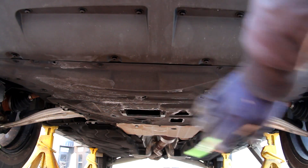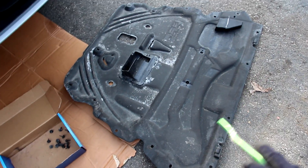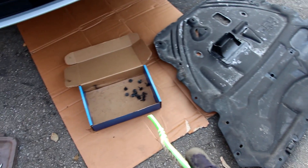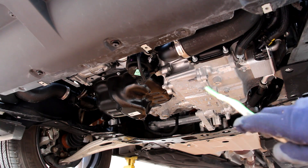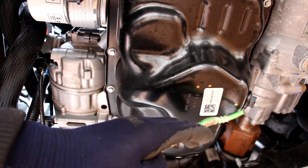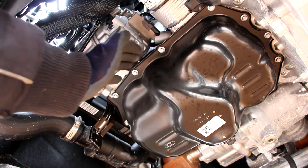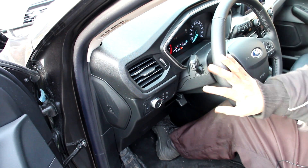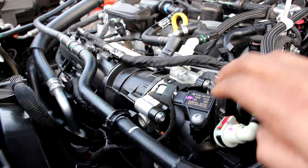The underbody of the new Ford Escape is fairly flat and most of it is covered with plastic, with the exception of the exhaust. One of the biggest oversights is that you have to remove this entire plastic panel — consisting of over a dozen fasteners — in order to access the oil pan to change the oil. I can see a lot of those fasteners getting lost over time. At least they include a fancy duct here to cool off the transfer case. Underneath we have the transmission on the driver side and the oil pan and engine on the passenger side. Changing oil in the Escape is pretty easy — we have the drain plug and a canister-style oil filter. Ford has attempted to reduce vibrations by integrating the oil pump with a balanced shaft just above the oil pan underneath the crank. However, my biggest issue with the 3-cylinder engine is that when you put the vehicle in drive you can feel vibrations all over the steering wheel and in the seat — it's not a very well-refined engine. This engine is vibrating quite a lot at idle.